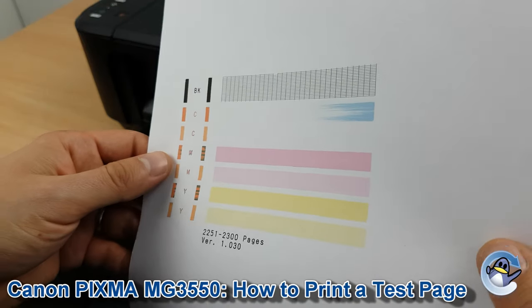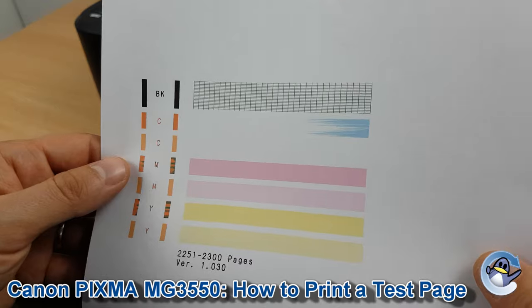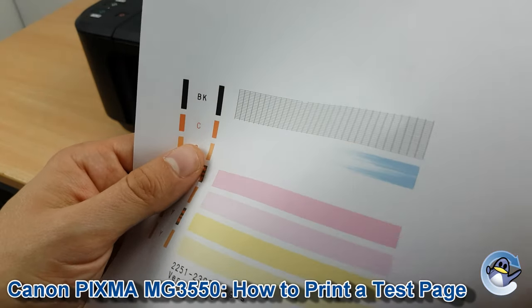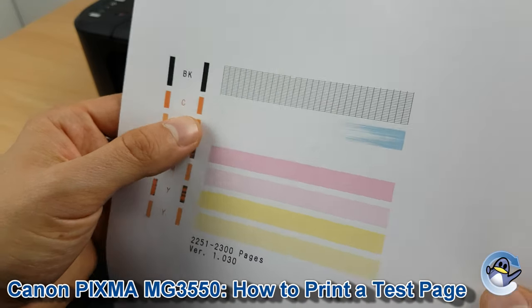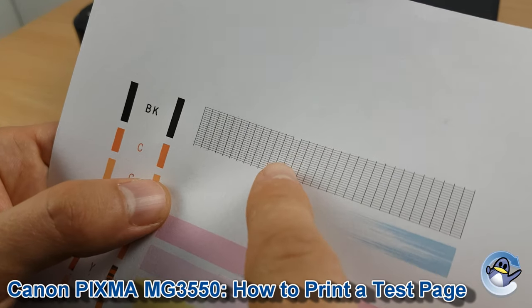What your printer has done is broken down the black, cyan, magenta, and yellow inks, giving you a good idea as to where any print quality issues lie. Any issues with this machine will be the lack of cyan, so I'd recommend running cleaning cycles to try and pull that ink through into the printer's printhead.